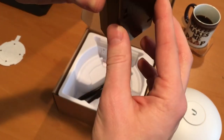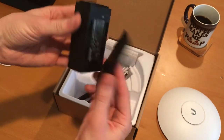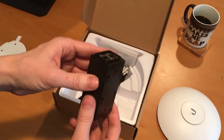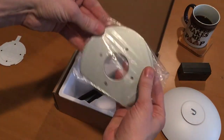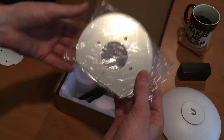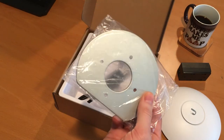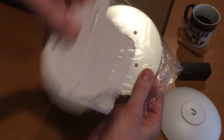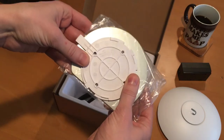Pre-drill the holes, stick your screws in, take your POE adapter — probably oriented upward like this on a wall — pop it in place. A lot easier to get in than it is to get out, contrary to most things in life. This other piece is a back plane, same concept as the piece of metal on the back of a motherboard where you screw your heatsink. If you're mounting this to a hanging ceiling, put this behind it, screw through the ceiling, match up the holes — bingo bango, you've got yourself a mounting bracket for a hanging ceiling.